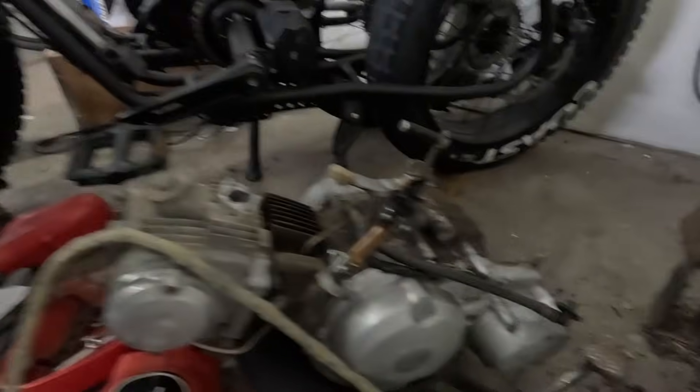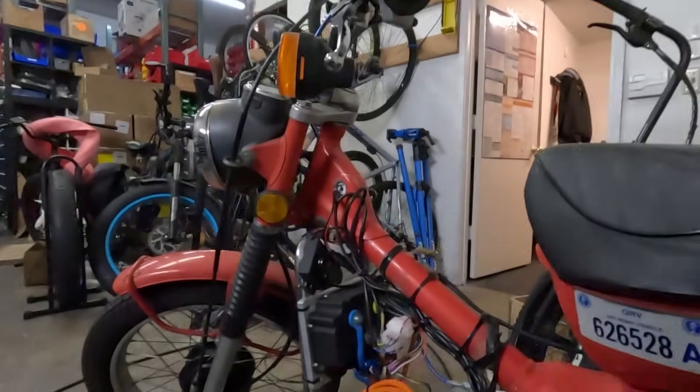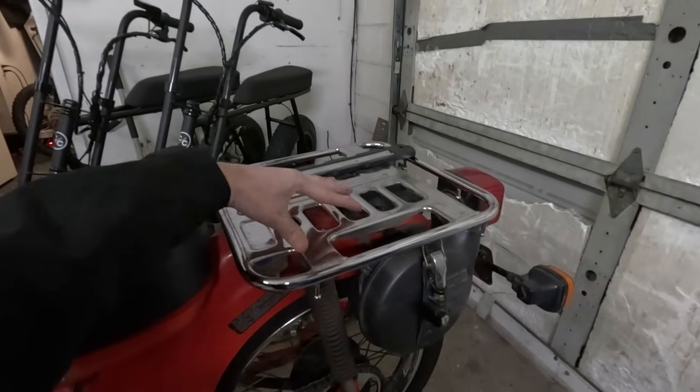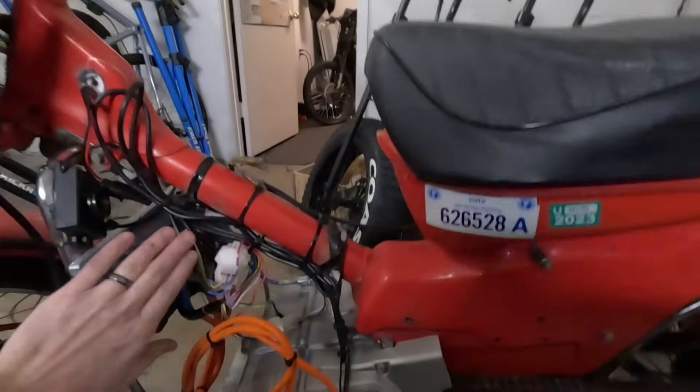It's actually about the same physical size and about the same weight as the original motor, so there's not a whole lot of weight savings — maybe a little bit. Top speed is probably about 50 mph. I didn't have a fully charged battery — I was running about 76 volts. At 84 volts which is full charge, I'd probably get a couple extra miles per hour out of it. Right now I just have the shark battery up here — I could run two and use a combiner to hot swap them. I could probably fit three or four up here actually, but then you lose the cargo space.